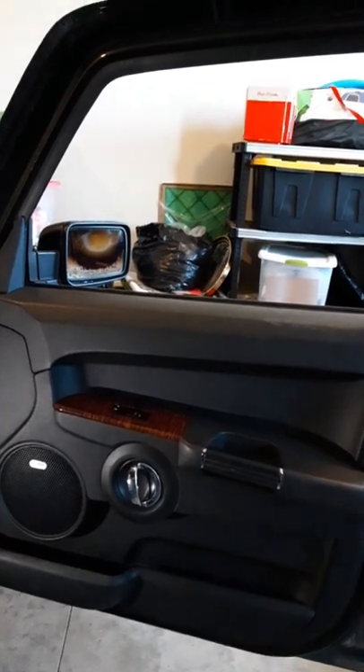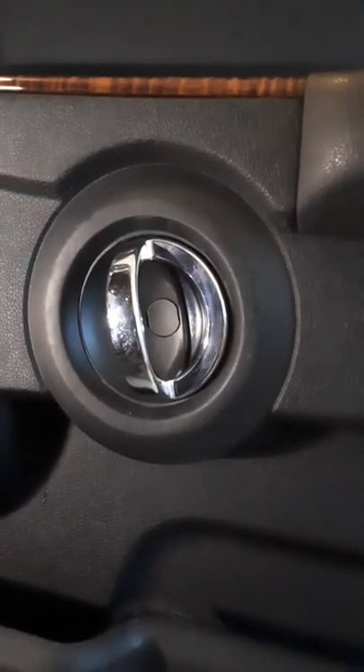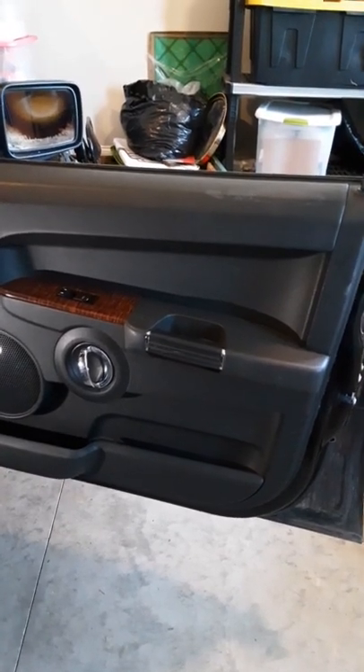Make sure you roll down the window first before you turn the power off. The first screw is behind the pull handle to close the door. A second screw is behind the pull handle lever which unlocks the door. And the third screw is by the hinge — only three screws, and they're Phillips screws. This job requires three screws, three wire clips, and three bolts. That's it.